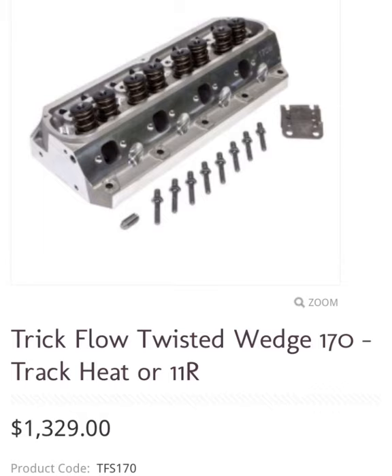That's my take — I'm not telling you whether or not you should buy a budget head, but those are the issues you're going to come up against, especially if you're boosting. It doesn't matter if you put studs on there — you're going to have a problem popping head gaskets because of the thin deck. There are plenty of people running budget heads with success, but strictly comparing the Enforcer heads at $1,100 versus the Trick Flow 170s, I think it's worth spending the extra two or three hundred dollars to get the Trick Flow heads.